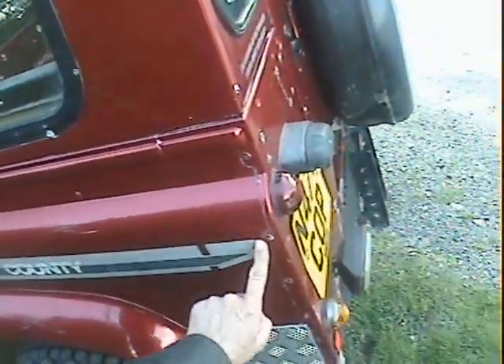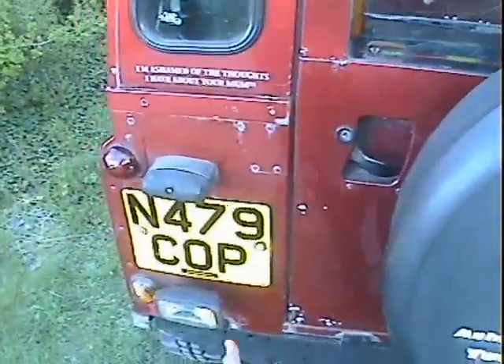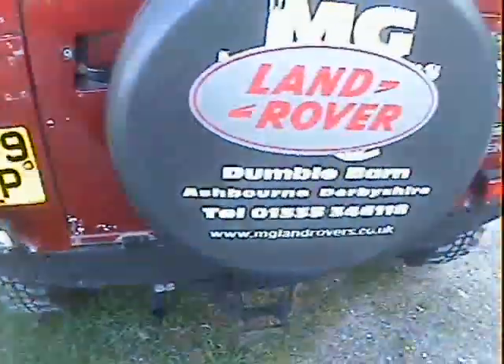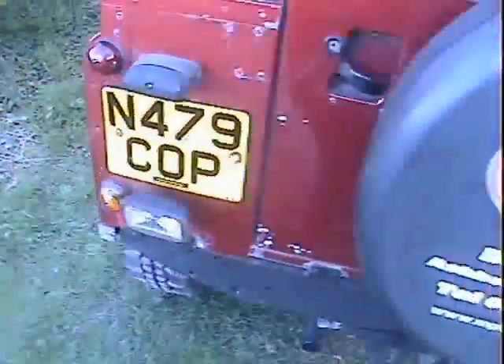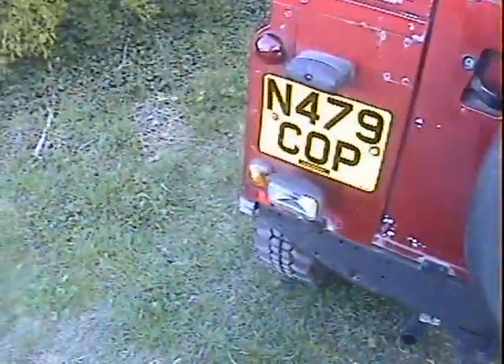The nearside rear eyebrow has lost a fair bit of paint around the front edge and there's a lot of paint cracking on the top of the eyebrow, plus some scuffing. There's some electrolysis reaction on the rear corner piece. Around the tail end there's quite a bit of electrolysis reaction up here and on the bottom of the tailgate. The cross member looks like it may have had some work at both corners and possibly in the middle as well — might have had some welding done.